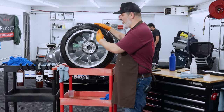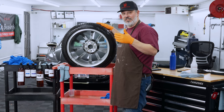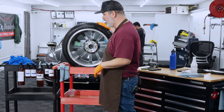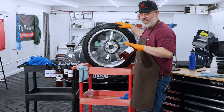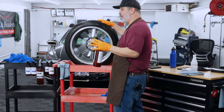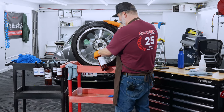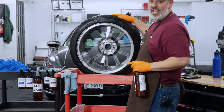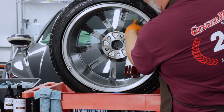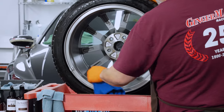I always like to start with the barrel so the forward-facing side finishes last and looks best. As far as order of aggression, one of the least aggressive things we can use is our prep wash — a 100% inorganic formulation typically used for paint correction preparation. We'll give it a shot starting least aggressive. Here's the contaminant — that asphalt stuck in there. As expected, not much change, so we're going to ramp up the aggression.